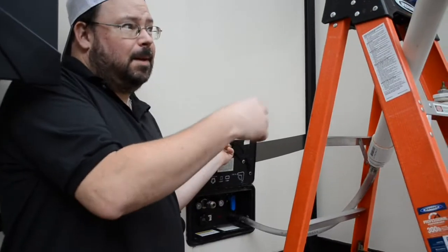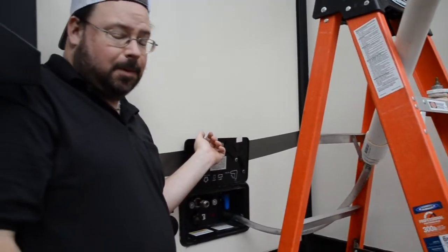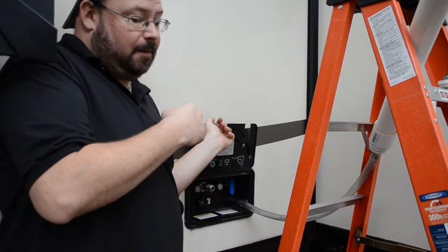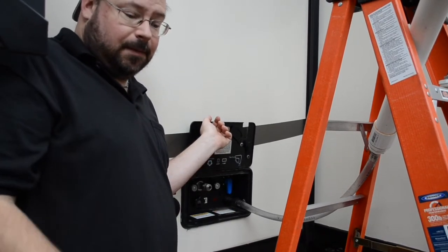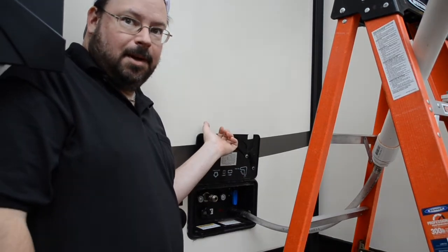Years ago, I made this contraption to be able to winterize not just campers, but pressure washers, all sorts of stuff. And what I'm going to do now is fill it with antifreeze and then use air pressure to push it through the lines and push the water out through the faucets, and we'll run each faucet until we get pink showing. And that's how we know it's winterized.